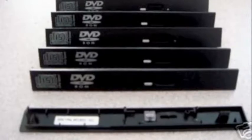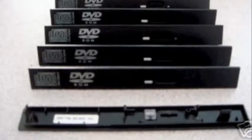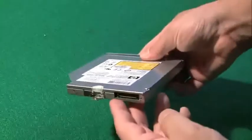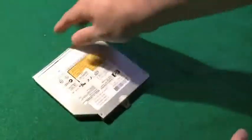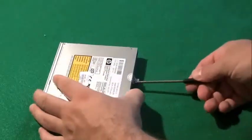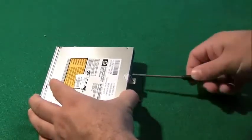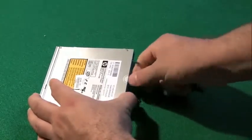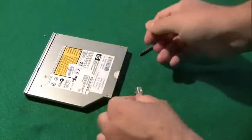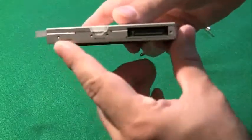So you can't just buy any drive you want and put it in that computer — you're going to need one that's compatible with the front plate. The other thing that's different from drive to drive is the rear fastener, which is where the screw that holds the CD drive in the computer gets fastened. This little piece of metal screws into the back of the CD drive, and the screw that holds the drive in the computer screws down into that fastener. When you take the fastener and the front plate off, CD drives are going to look for the most part identical from model to model.